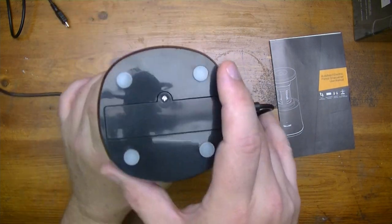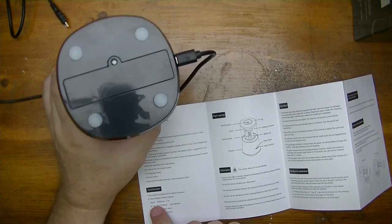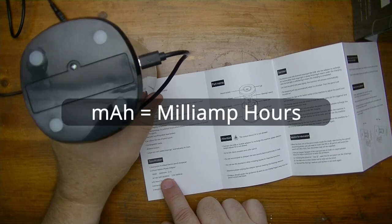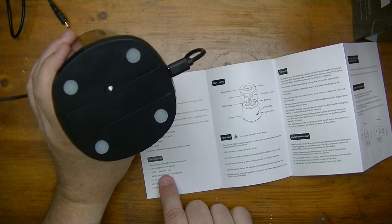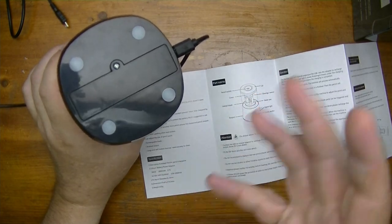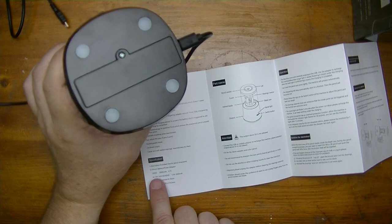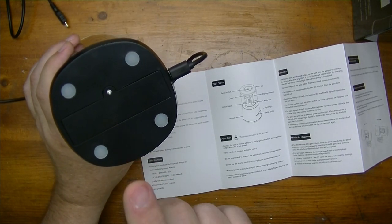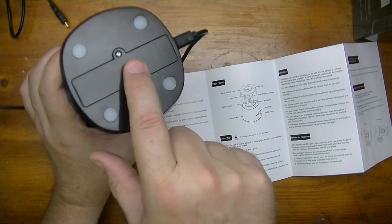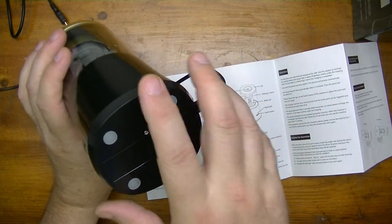Inside on the bottom is a rechargeable lithium battery — an 18650, which is a type of battery. This one is 2000 mAh at 3.7 volts. You can replace that with a higher milliamp-hour rating like 5000 or higher, which is how much charge it can hold. The battery is swappable, and you access it through a screw. Just make sure any replacement is a 3.7-volt battery.